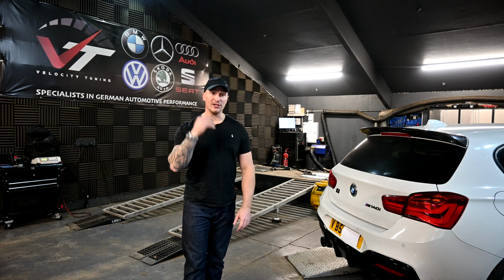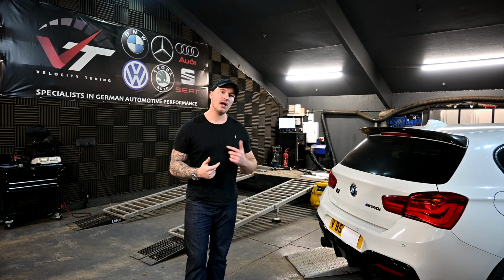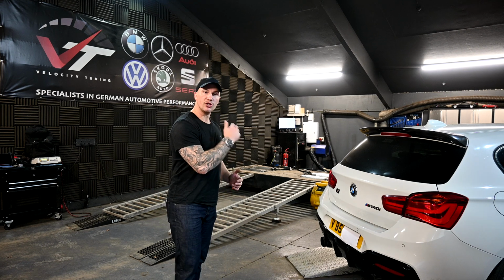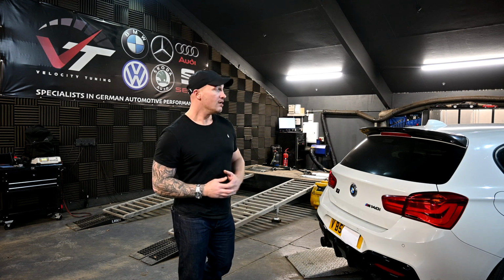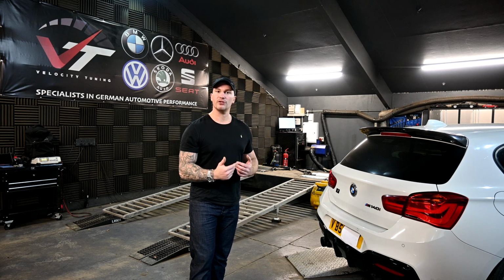But as you add turbos and fuel pumps and meth kits and want to run ethanol, you want to do all this crazy stuff, that's when you might need a bit more flexibility. You might want a map switch, for example, you might want a data log, you might want to turn the burbles on and off. There's loads and loads of customization that comes on those platforms. So we chose to move this one onto BootMod3. He's got all our Velocity tunes on there, but he can switch between which one he wants to use.